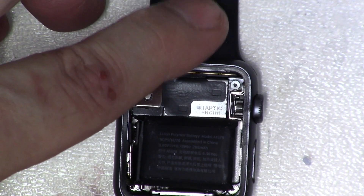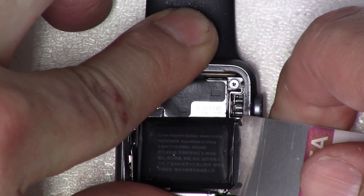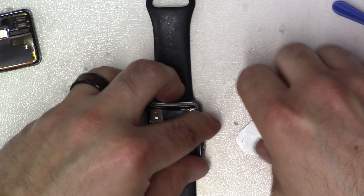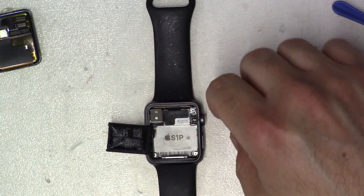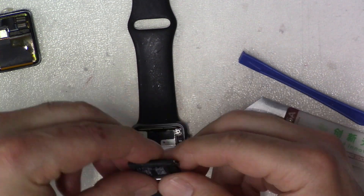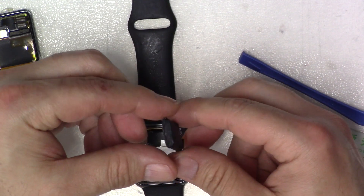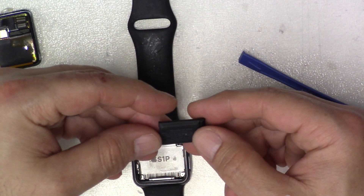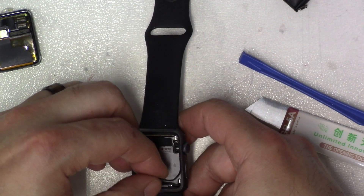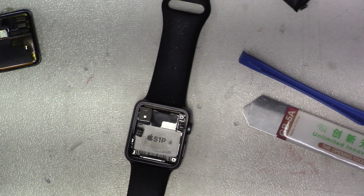Alright, it seems like it's coming up. Using this pointy edge to try and get under there a little bit more. Battery's out — just pull that with a nail and it's disconnected. You can see that battery is definitely bad; it's exploded. There's the sensor there. I wonder if we need to replace the glue around this as well because it doesn't look like it's holding, and the instructions are pretty crappy.